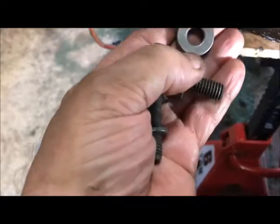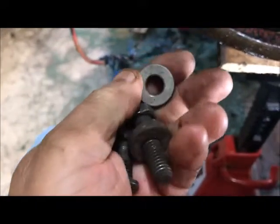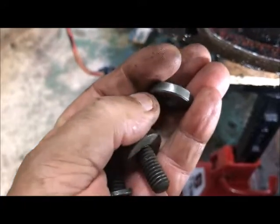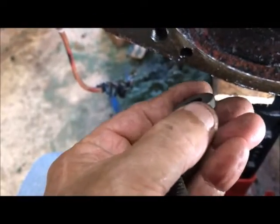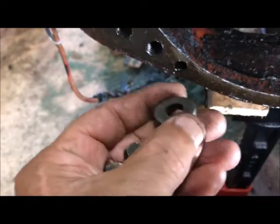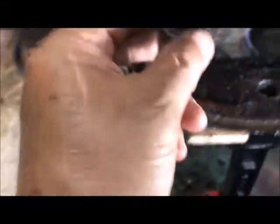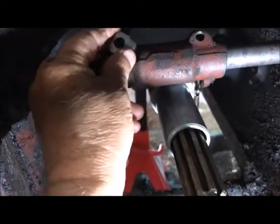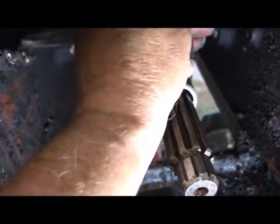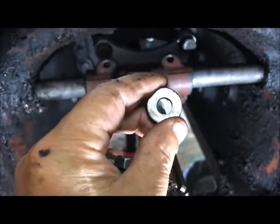For those who've never messed with this yoke on the clutch throw-out bearing, this is an interesting little washer - it's a keeper. Rather than a Woodruff key or a regular key, this is a keeper that goes through this side in between the two little tongues here. It sticks back into the shaft, and then you put a bolt through it.